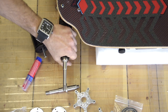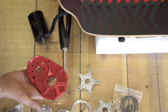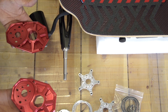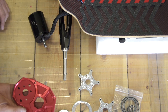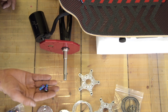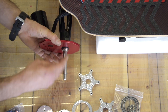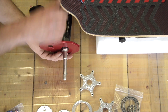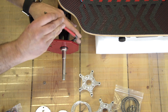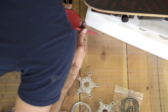This is a fairly important part of your assembly, so don't be scared of tightening it properly. Next step will be installing the motor plate. There's one for each side — we have the wire slot for the motors and they are symmetrical, so one for the right side and one for the left side. Start with the right side. You will need the big M8 by 12 screw — it already has thread lock on it, so you don't need to apply again. Use a 6mm allen key.